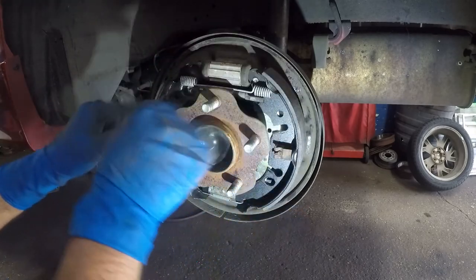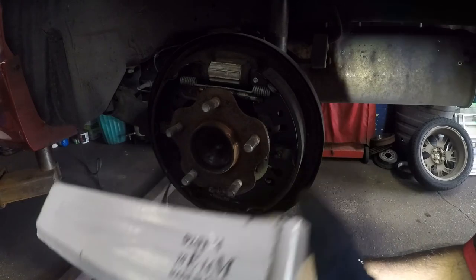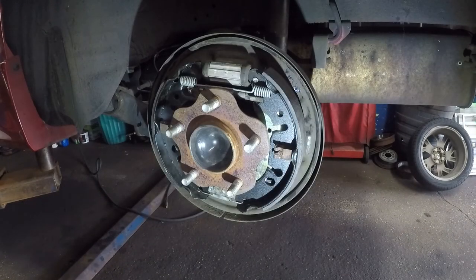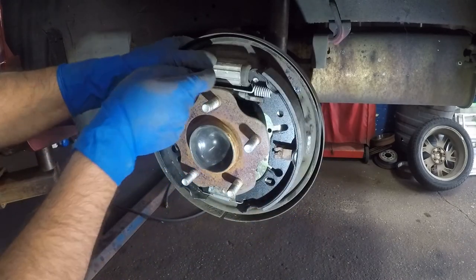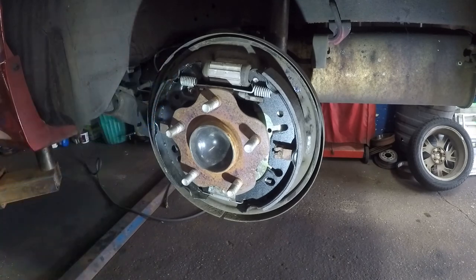Adjust your brakes. Make sure they catch on to the drum pretty well. I'm going to show you the drum part number. This is the drum I'm using right here — that's the part number. Do clean out your drum with parts cleaner before you put it on. Double-check everything — everything should be nice and solid. You can always check if the cylinder is leaking just by pushing the boot out of the way. But I'm done here — I'm going to adjust and put the brakes on.